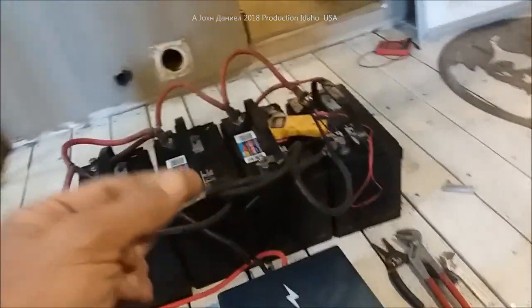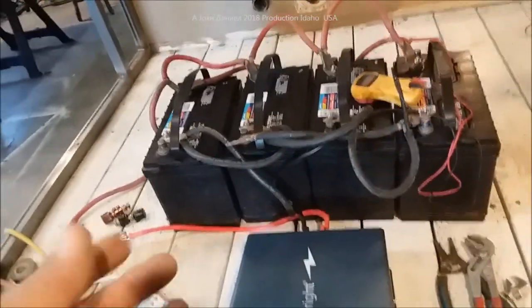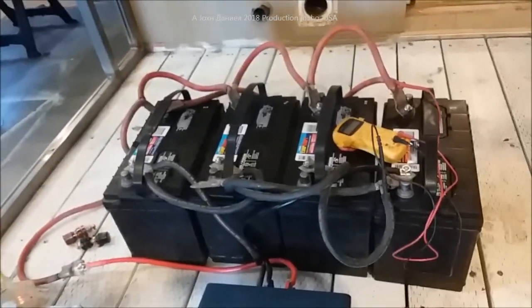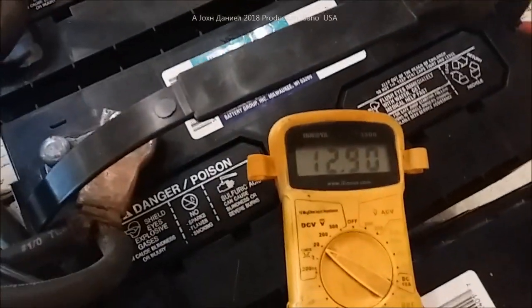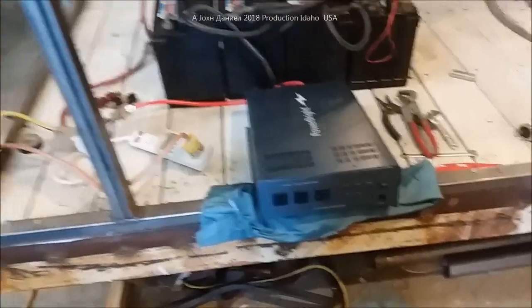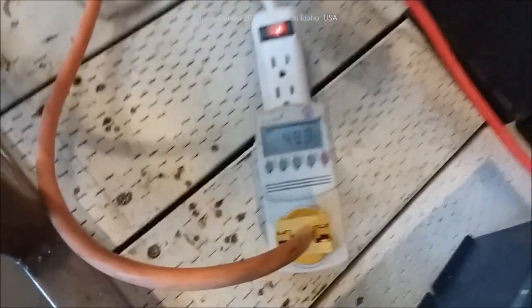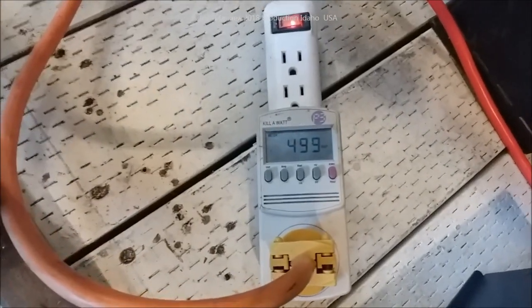So 800 watts of solar, a 2200-watt inverter, and four large batteries at 109 amp-hours apiece - these are the EverStart. You'll notice them by the pattern on the side - they're not smooth-sided like a regular Johnson Controls Walmart battery. These are the Champion X-Side / NAPA battery design. They're currently sitting at 12.9 volts static - they're brand new. We're going to hook up this inverter. Remember these batteries will have incoming solar when the air conditioner is running.